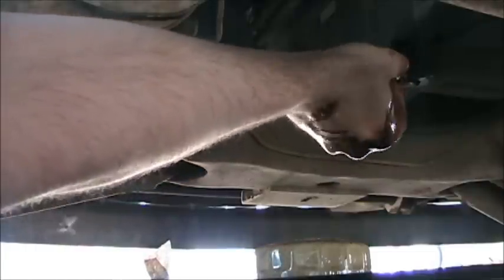We've got everything cleaned, so now let's put the drain plug back in. It's magnetic, so it wants to stick to the pan, which is neat since it's a steel pan and in great shape. Finger-tighten it first, then just snug it up. You don't want to make it Superman tight — the threads on the pan aren't that thick, so don't go too crazy. But you do want to make sure it has good contact.